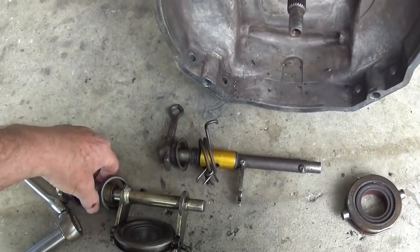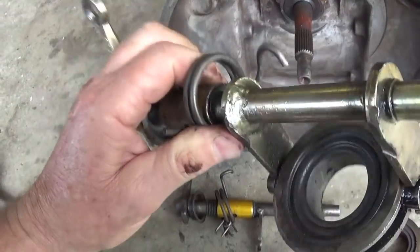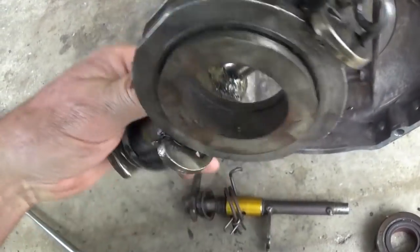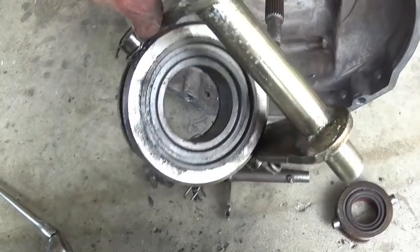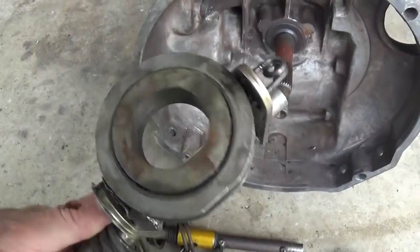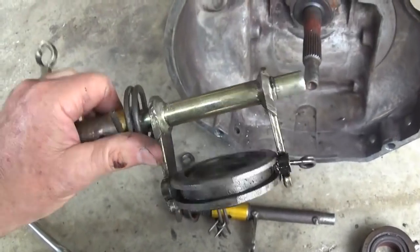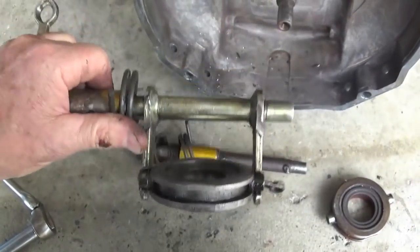At any rate, when you do that sort of stuff, you might consider going with these heavy-duty cross shafts. Now, this is a racing-type cross shaft tranny for the early style swing axle. But it did catch some of the early IRS as well. You just have to use the right throwout bearing. But there's nothing to keep it perfectly centered.